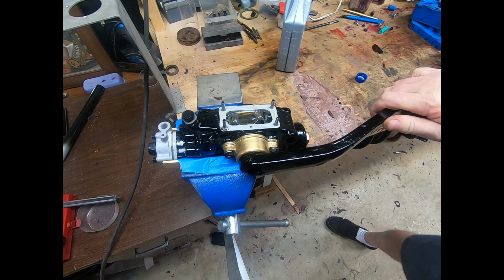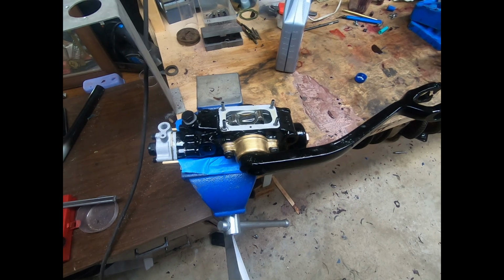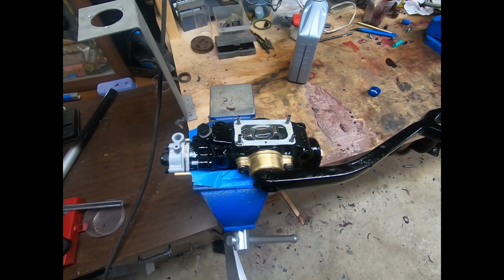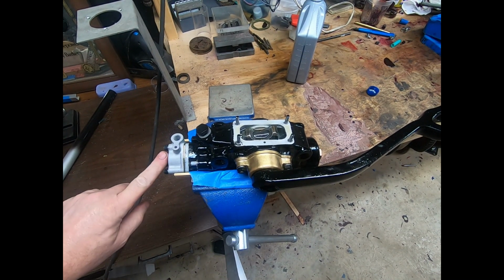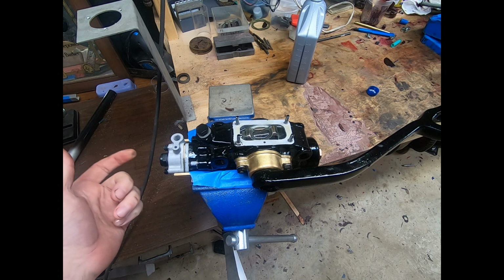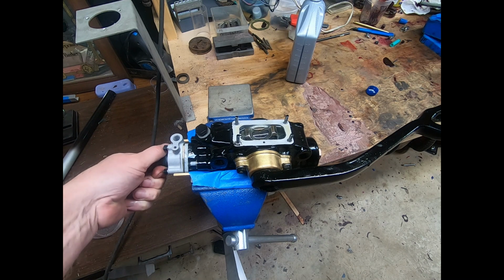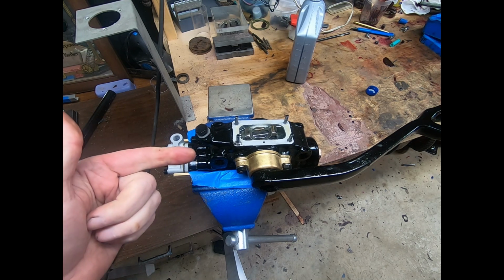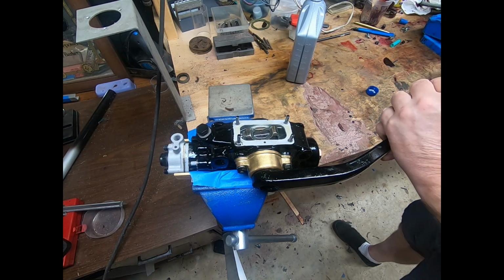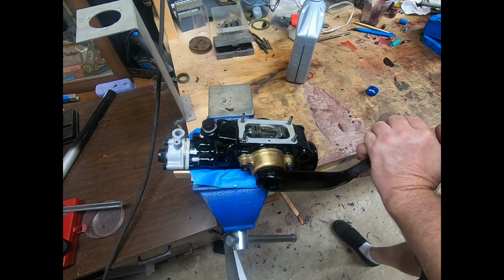So now another thing I'll demonstrate here is inside the cap I just put on. So I'm bringing the camera up to it. Right in here, you had the stem of the bellows sticking out here. So inside this cap, I experimented by putting a small nut inside here to press against the bellows. So as I tighten this nut up, that'll push the bellows, which will push that spring and then close that valving sump. And in doing that, that has significantly made this harder to press down